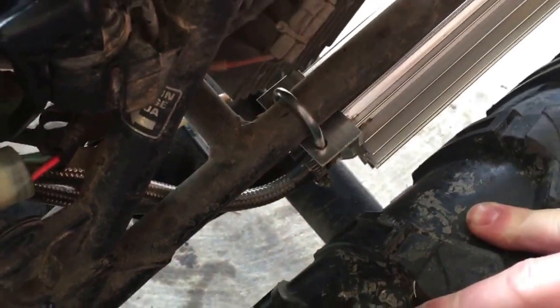I wrapped them and re-wrapped them with duct tape after I got done. Important note: don't install these lines until your very last step, when you're absolutely certain you've got your hose clamps ready. Once you push these hoses onto the barbed hose connections you won't get them back off very easily, and then you'll be mad at yourself. Just something to think about.